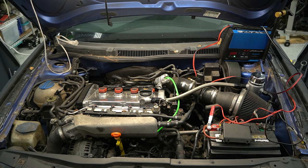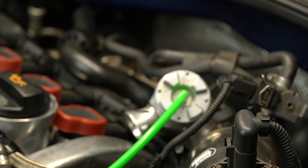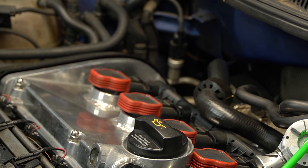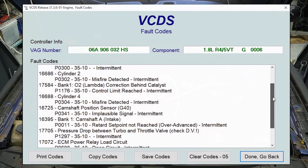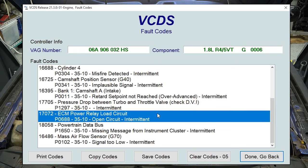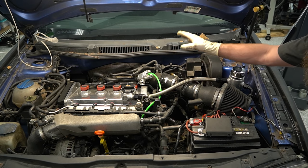We'll do a visual inspection under the hood to make sure we don't have any glaring issues, keeping in mind that we have that one boost hose that may be rubbed through. We're also going to scan faults and see what kind of faults we've got that may point us in the right direction. It looks like a weird, dirty, maybe collapsing air filter. There's also a blow off valve, which makes me wonder if that's somewhat related to our drivability issues. I'm also concerned about the tune the car has on it. Otherwise, it's actually not terrible under the hood — this valve cover is pretty nice. We do have a bit of unsavory wiring at the battery, but compared to some of the Mk4s I've seen, this actually isn't all that bad. We got a lot of fault codes stored in the system. The airflow meter is a super common problem, but because we still have some pieces of this puzzle I'm not sure of — including the tune — I'm not going to throw one on just yet.